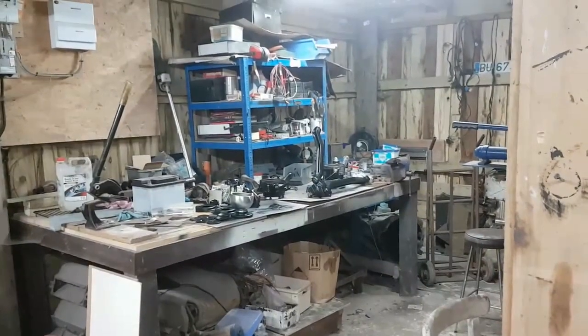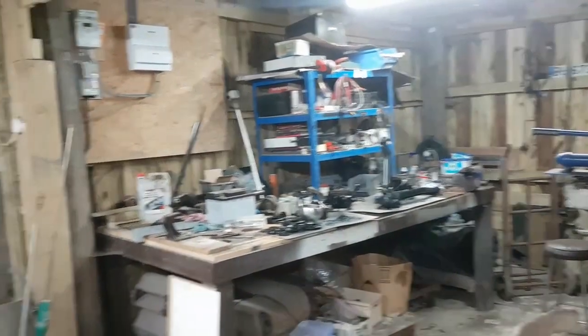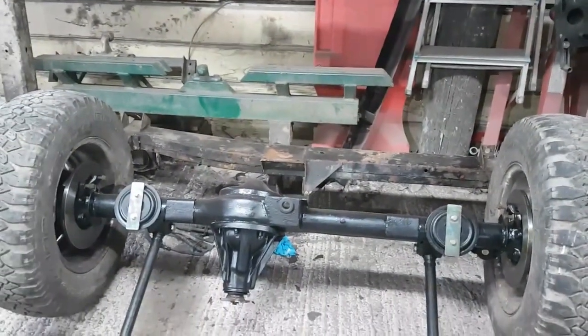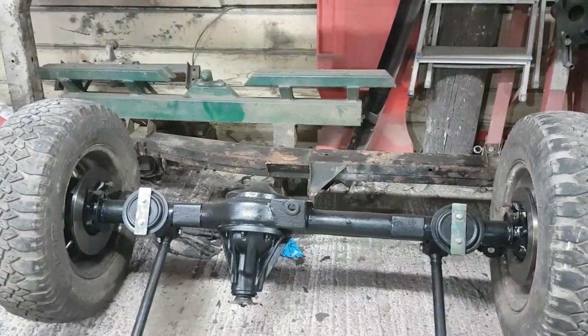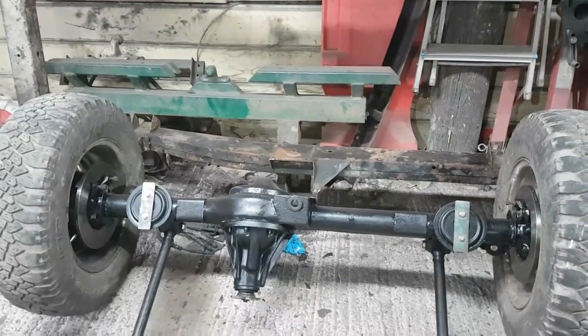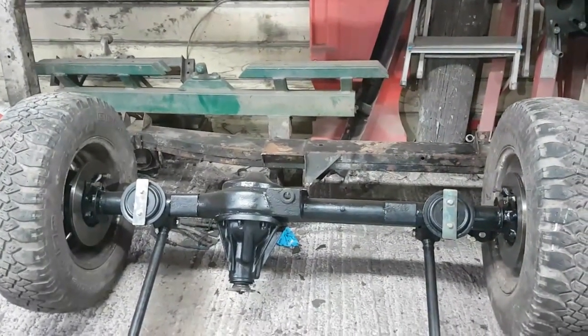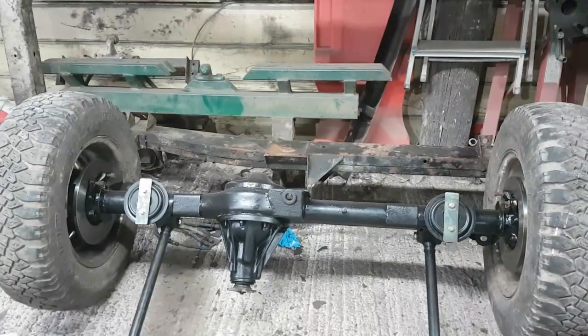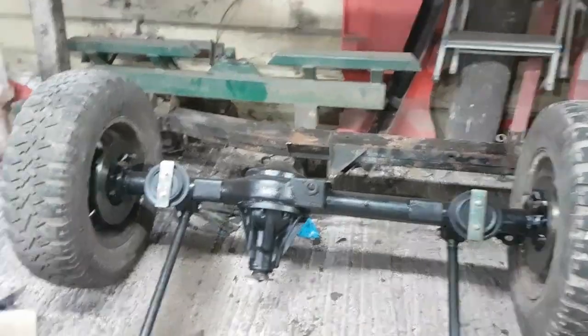And the other project I've got to do is a Land Rover Freelander 2 TD4, which has just failed its MOT. Claire up the pub is desperate to have it fixed, and I said I could do it for her. So 3 of the 4 wheel bearings need changing. Both back dampers need changing. And it needs a mini service. But, yes, that's about that really. Right. Let's get on with this bloody thing, put it together.